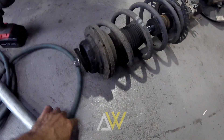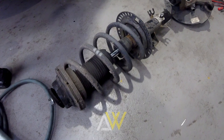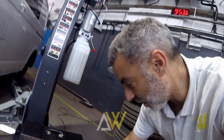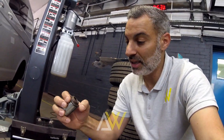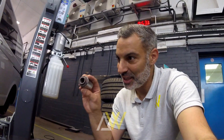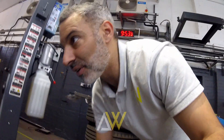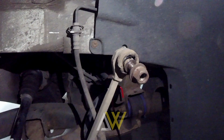What I also saw on their video was that you use the factory top mounts, otherwise you end up with squeaking, knocking, or rattling - which I don't want to find out about. We're going to do that. Along the way we've had to sacrifice a 32mm socket to the hub nut. This hub nut is a self-locking, self-tightening type - it's narrower on the top end than the bottom, so as it goes on it basically tightens itself. Because of that you need to replace these anyway, so we're getting two new hub nuts from a local supplier.